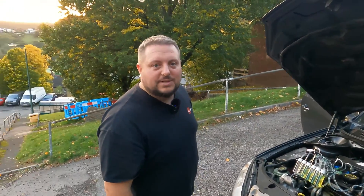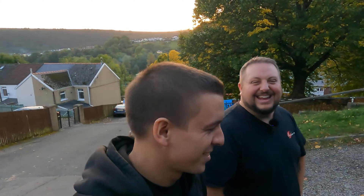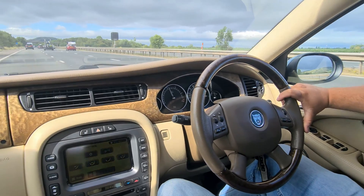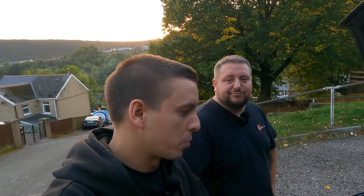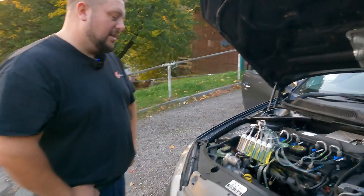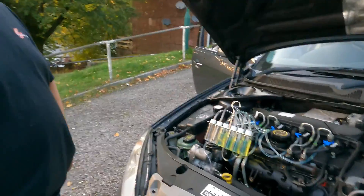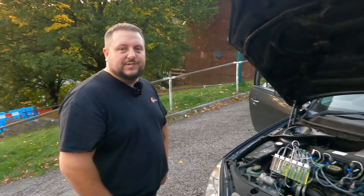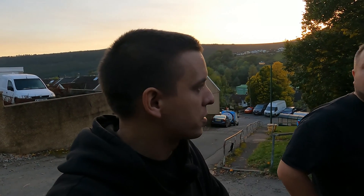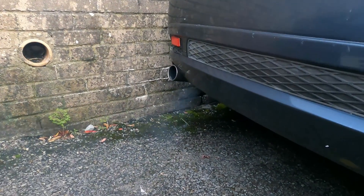We'll see what else we can strip off and see what else we can do. We're going to do the Jag as well — mine doesn't seem to have the problem, but I want to do the test anyway for peace of mind. It'd be good to do mine and see the difference between a two litre and this 2.2. As for what's causing the smoke — it could be the DPF, we haven't had that apart. I had a 70 mile an hour judder after a long run, turned it off for 20 minutes, started back up, and when I went on the motorway I had a bit of a judder. If you guys know what that could be, let us know.